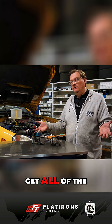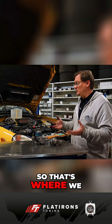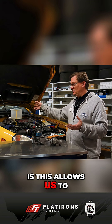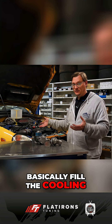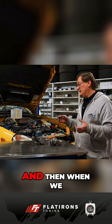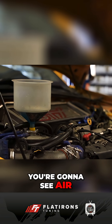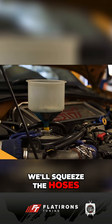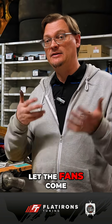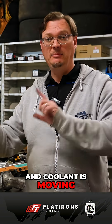There are just obstacles to get all of the air out of the system easily, so that's where we use something like a spill-free funnel. What this does is it allows us to basically fill the cooling system up, know that we've got a little bit of extra coolant there, and then when we start the engine, you're going to see air bubbles come out. We'll squeeze the hoses and get all of the air bubbles out, and then we're just going to let the engine idle and come up to temperature, let the fans come on a couple times, because then we know that the thermostat has opened and coolant is moving back and forth between the radiator and the engine freely.